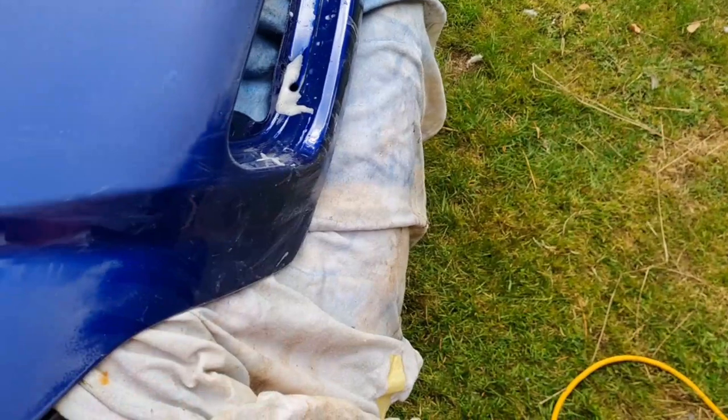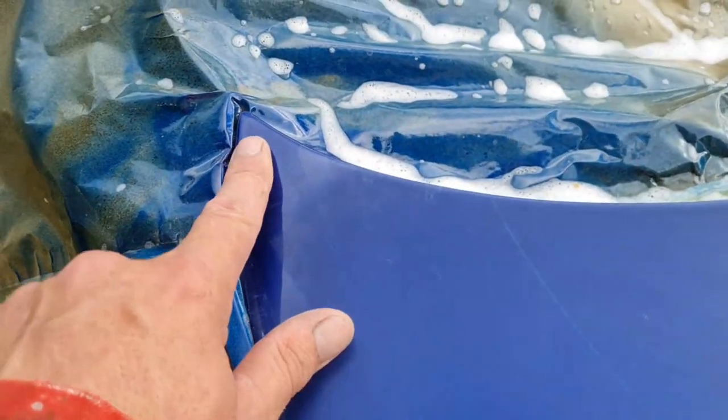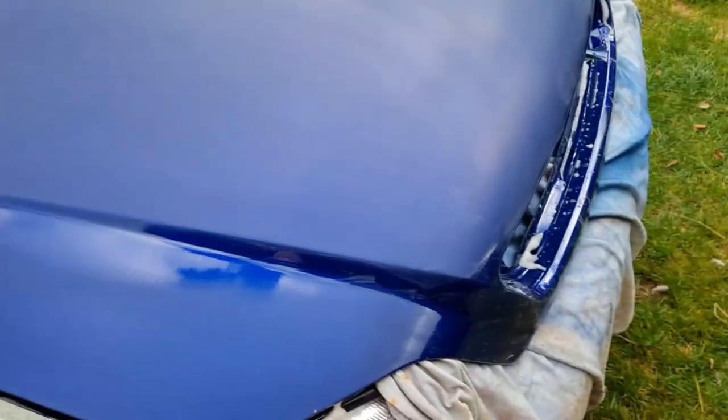Same again, I've left this bit here of wet sanding. Because you don't want to hand around the front, because there are bits that are really, really prone to going through with the mop. Same with your corners, look, leave them. Just do the bulk of the area. And as you can see, there is no little bits of crap in that anymore. All the crap has gone.